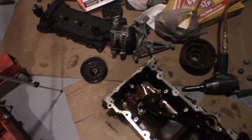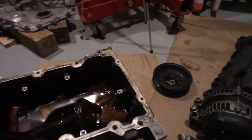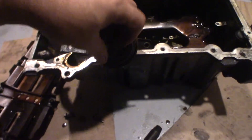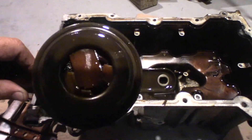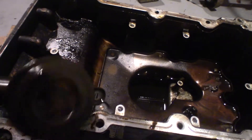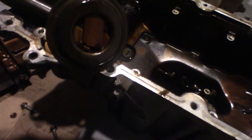We have the oil pan out of the vehicle — and something very concerning: I pulled the strainer, the pickup tube, and I found pieces of that liner from the tensioner stuffed in there. My instincts to pull the oil pan were good, plus it just looks like it could use a good cleaning. But now my concern is: did the engine get starved on oil? And what does that mean for the car now? That's a scary proposition — we're going to find out.